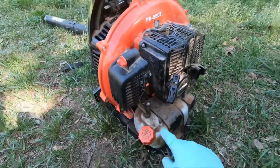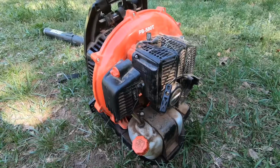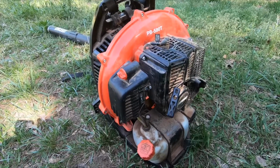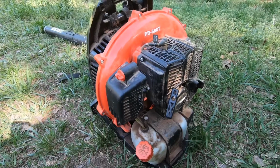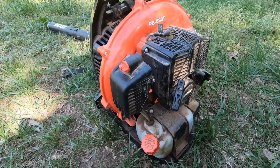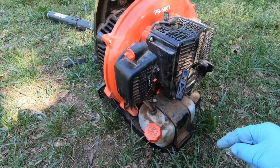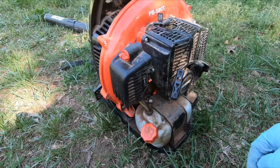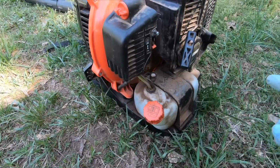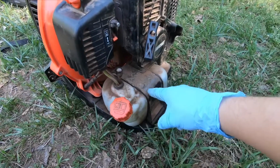So anyways, first, of course, we have to put the fuel in. This is a 50-to-1 fuel ratio. You're going to need basically 2.6 ounces of the oil mixture. I prefer the Echo kind, but you could get any kind you want, and you mix that to 1 gallon of fuel. I just made a video for you guys on how to mix that, and you could watch it. There's going to be a link in the description below to that video. Fairly easy. So basically you open this up, this is the gas cap, and you pour that oil right in.